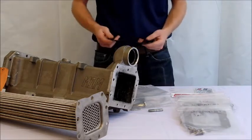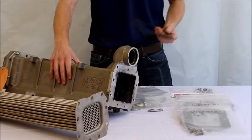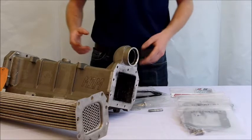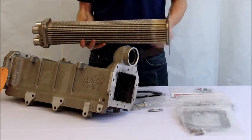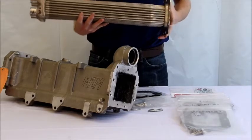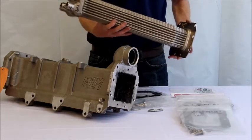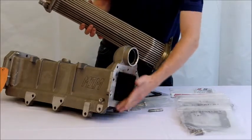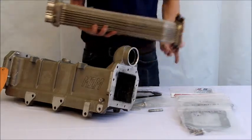We've primed the manifold body of the EGR cooler for the insert and now we can actually install the insert itself. Take the cooler insert and remove any cardboard wrap around the neck. Make sure the cooler is cleaned off so it has proper seals all the way around — check the flanges and make sure there's no debris on the low temp side.